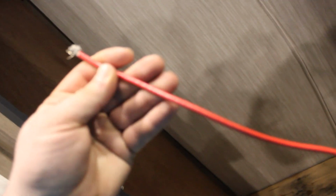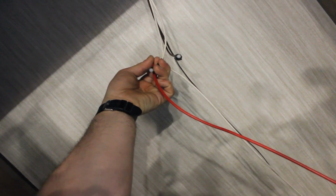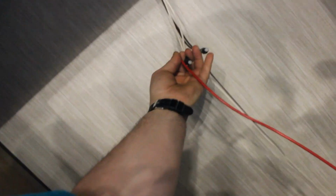All right. So my point is it's got two 14-gauge wires for the power, two 14-gauge wires for the ground, and then it goes to a single to the fridge. I'm just going to step the wire up a gauge, and I shouldn't say a gauge, so probably what the whole thing should be. I'm going to feed it with 10 gauge, and from what I read, 10 gauge is what they're recommending. But you can see the difference here in size. We're just going to take the two wire to a 10 gauge, and then the other two wires to the other 10 gauge.